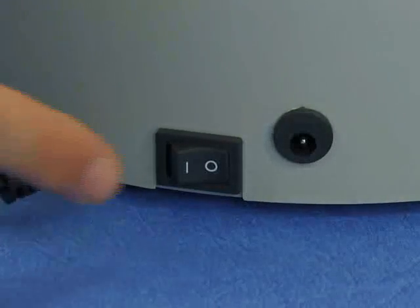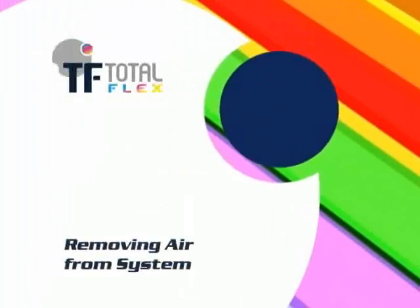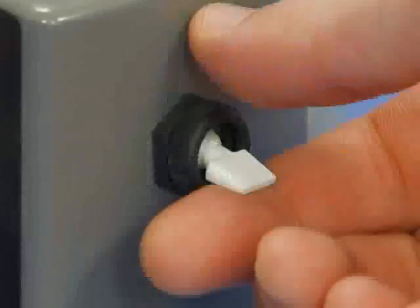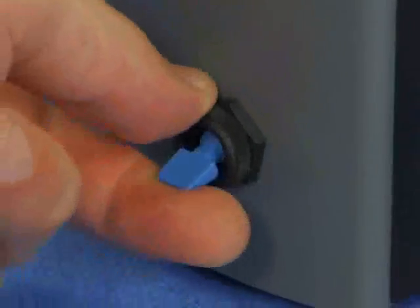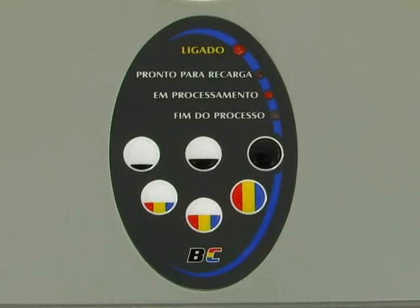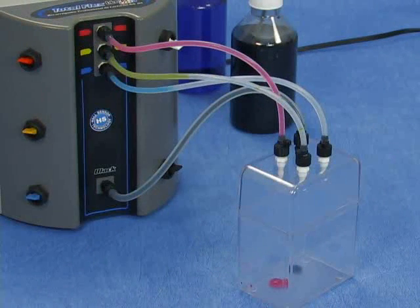Use the selector key at the machine's side panel to power up the machine. Connect the ACD to the machine through the power cable. Removing air from the system: before refilling cartridges, the hoses should be full of ink. With the machine's power on, lift the white key. Afterwards, lift the keys corresponding to the inks to be used during refills. Now turn down the white key. Check the processing LED — it will start blinking, showing that the machine has started its self-cleaning cycle. After a five-second pause, the hoses will be automatically filled with the selected inks, drawing the air out of the system.